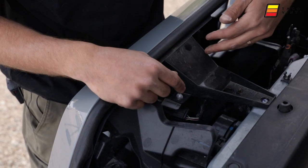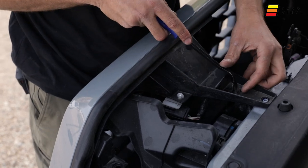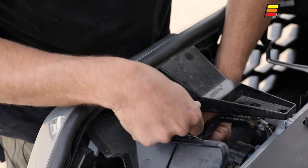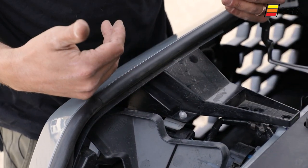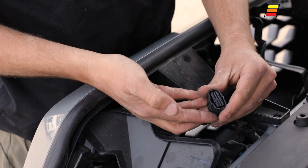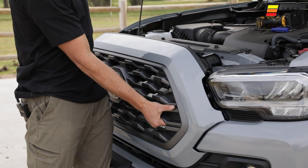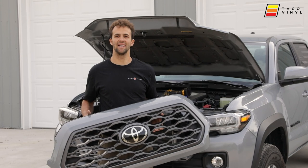If you have a 2018 or newer, you're going to have the TSS sensor located right here — that's where the plug-in goes down into the sensor. Compress the brown clip to get it through, then squeeze the plug from beneath and disconnect it so the grille can fully come off the vehicle. Once you get everything removed — the 10 millimeter, the clip, the plug — just give a firm tug to pop the grille off.